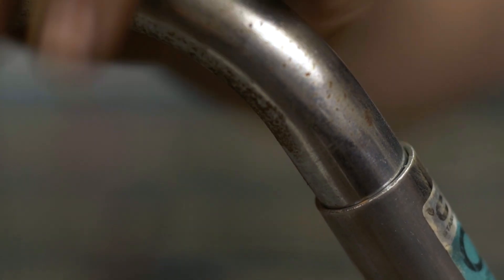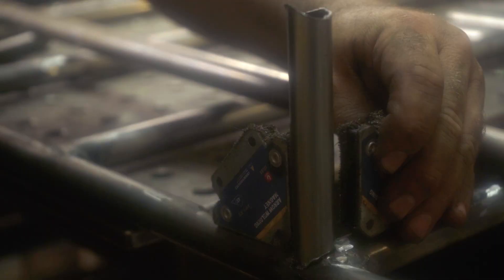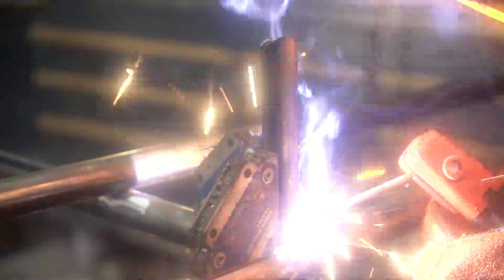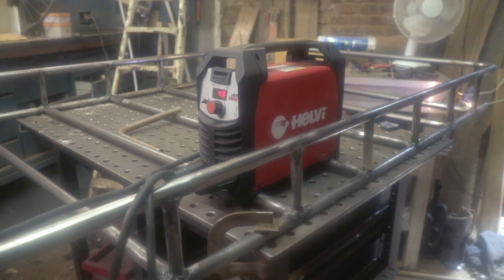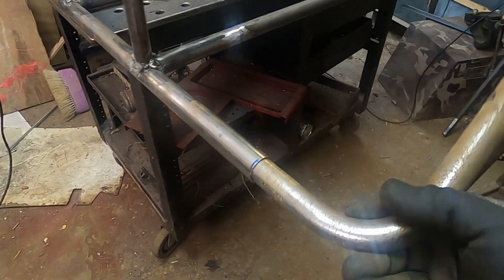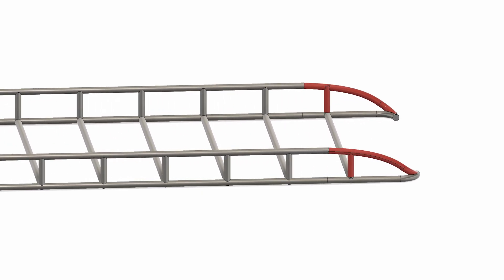So I want my roof rack to look professional, like something bought in a shop. It's very important to use the fixture table to align all the parts properly and keep always the same distance while welding, so even if the police stop me, the rack looks like something I purchased. You can see that the 90-degree corner fits precisely inside the bigger tube. I can use magnets to keep them perfectly vertical in both directions, then weld them in place. Now I really understand why roof racks like this are so expensive — it takes a lot of time to build.